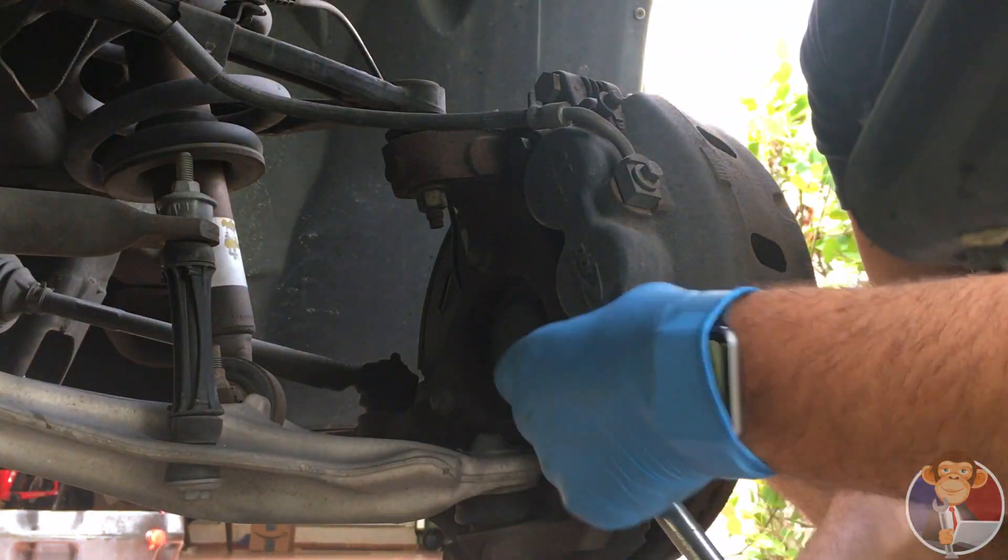So I got the C-clamp off. You can see my slide is already nice and lubricated. I'm just going to put the caliper into the slide here, nice and straight. Push it all the way in and then flip it down. If the caliper does not fit in, it's probably because the pistons aren't all the way back — take it off, put the brake pad back in, C-clamp and tighten it more. Now it's ready for the bolt and you can put the wheel back on.